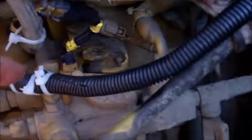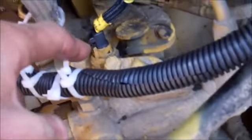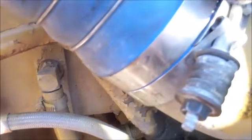And then I remembered that when they had to replace this booster sensor, the actual sensor had a piece of wire on top of it, not like this one. Like this one, the sensor is inside over there. There's no wires, but this one comes already with a wire. So that's what I figured, that you have to unplug that piece from the rest of the factory harness. And once I did that, everything became simple. You see, I just unplugged that, and I plugged my own in there.